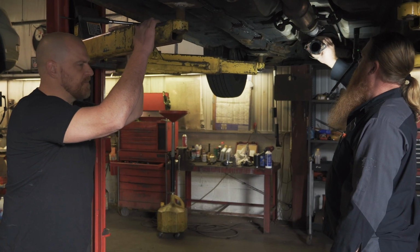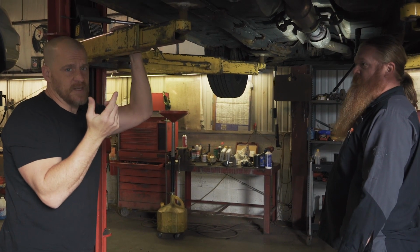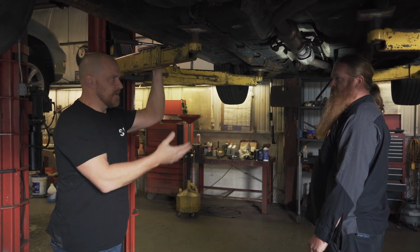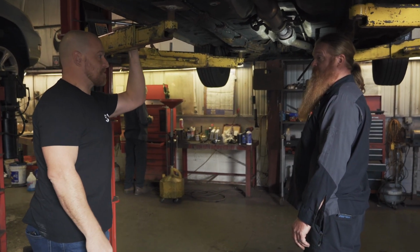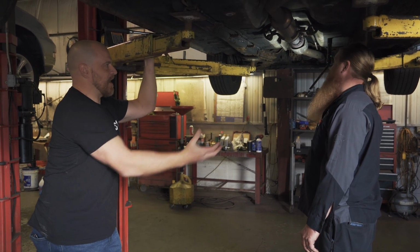Maybe you can add some insight for us here too, and this will be for our viewers. Our first car we're looking at today is a 2013 Ford Expedition with a driver's side low heat complaint. Those are known for the actuators that strip out, which is a 6-hour job, by the way. You got to rip the whole dash apart to get to it. Driver's side heat, it's right in the center area.